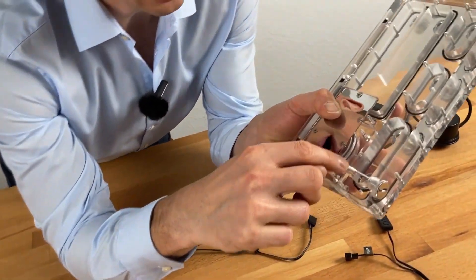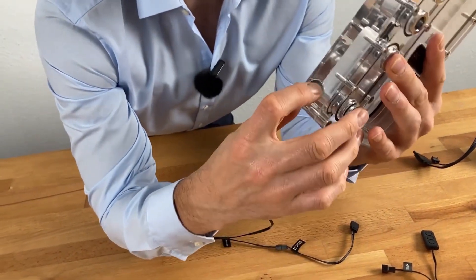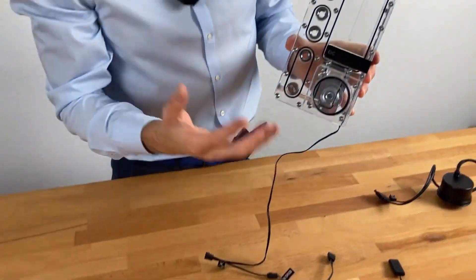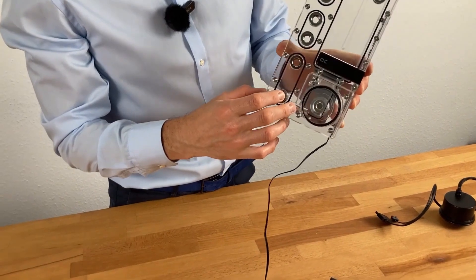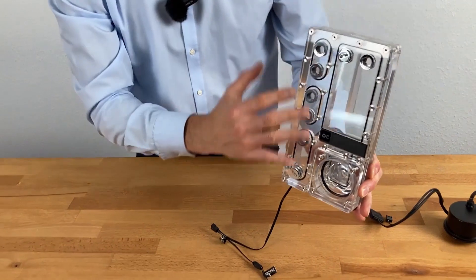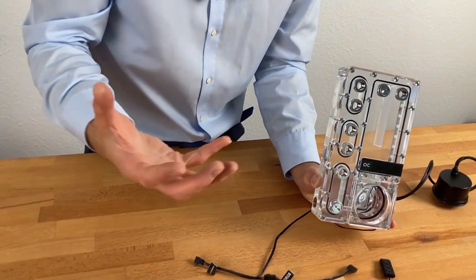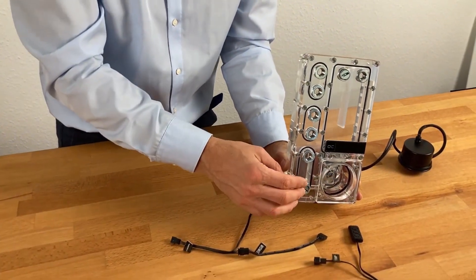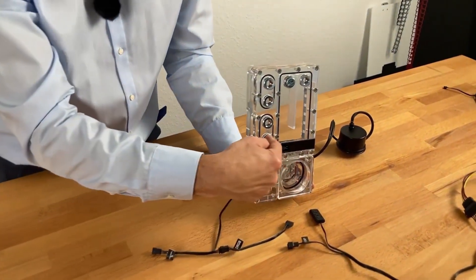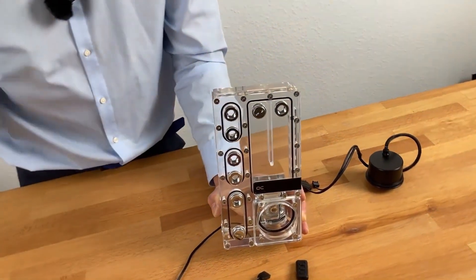The water goes out here and from here you have several outlets. It goes from the pump to the reservoir, and there are outlets here and here. There are so many options you can use. One of the most important things is you don't need to worry about the dimensions — just put it anywhere. When the water comes out here or here, choose whichever is better for your mount. If you go to GPU, maybe this would be better, so you connect these and go out to your GPU and back in, then out to your CPU and back in, then out to your radiator and back in. That's basically the idea.